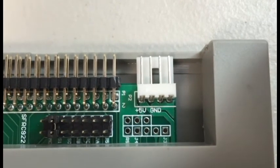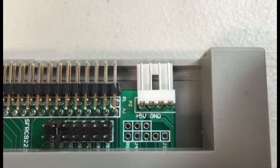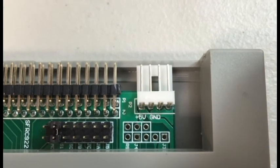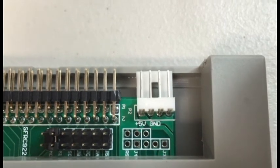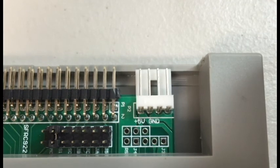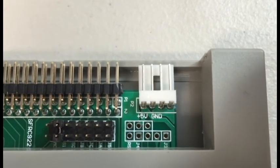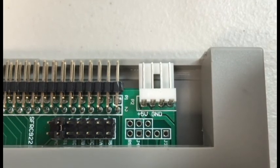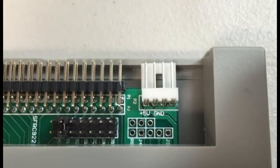Basically what we're going to do is set up a programming interface that will allow us to flash this drive using HXC firmware. You hook it all up with a programmer, run a specific program that the HXC folks allow you to download, and once you've made a successful connection it will ask you for a license to install a bootloader onto the device. That license is sold from the HXC group, and it's great that they welcome being able to take this device and flash it using their firmware, making it a cheaper option for folks.